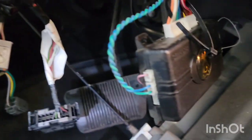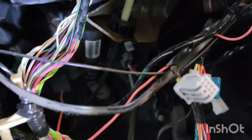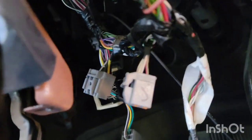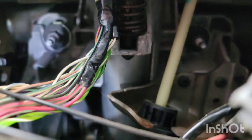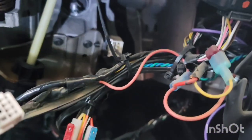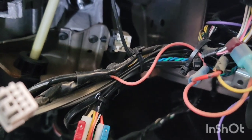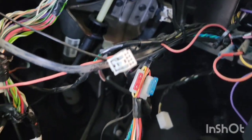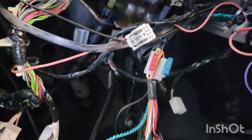I cleared the alarm that was in the way and removed the zip ties. Look inside and see what needs to be cleared. I had to remove one that was attached right behind there. The only thing left from what I can see — I'm trying to angle the camera — there it is. You can see one of the bolts; there are four of them, 13mm. The steering column should come down. There's one connector already disconnected, and that looks like it's attached to the steering column so it should come down with it. The rest of the wires are hanging right across — hopefully there'll be enough leeway when it comes down.